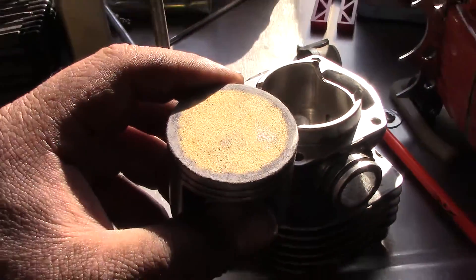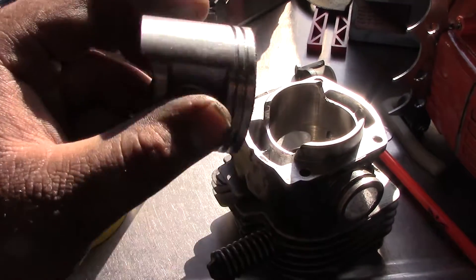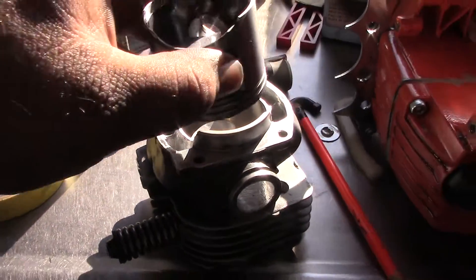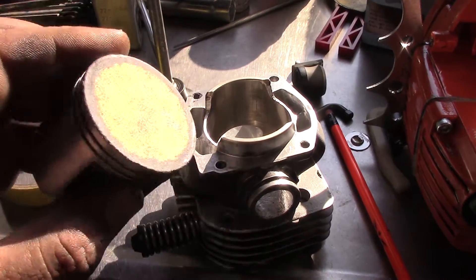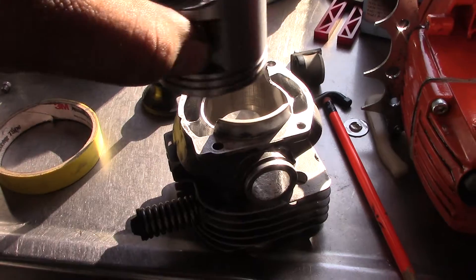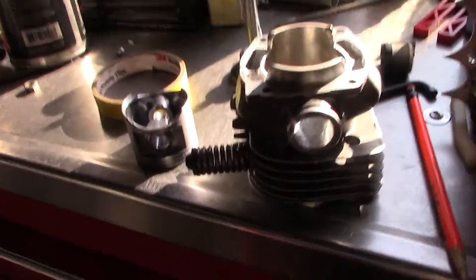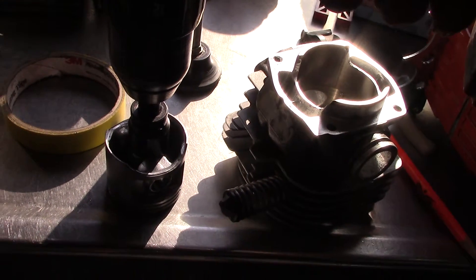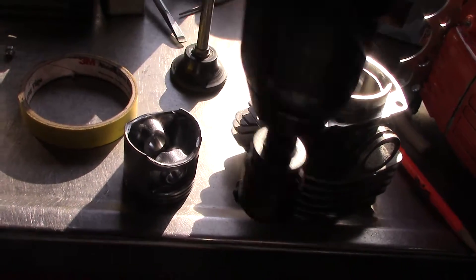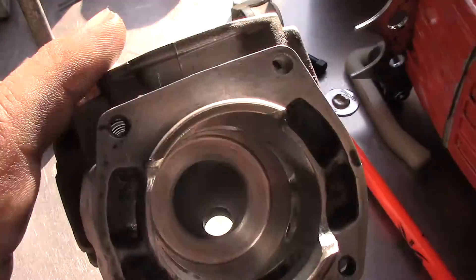When I got close, right here is the piston. I put this piston down in there, spun it. I got some super glue, super glued with sandpaper on there, just sand it in there. And I used this drill — it's right down in that wrist pin slot — you just run the drill, spin it. A lot of work here.